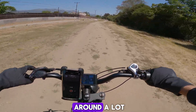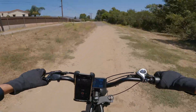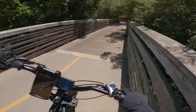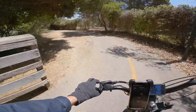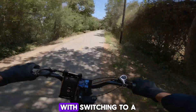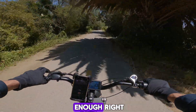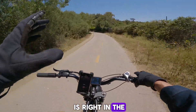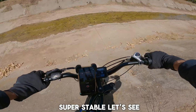It handles the off-road section pretty well — after all, this is a dirt bike frame. The kickstand does shake around a lot so I'm going to have to figure out how to tie that in. One thing I was a little concerned about with switching to a more dirt bike style frame was whether the center of gravity would be similar enough, but because I have this big battery in the center, the center of gravity sits right in the middle to lower end of the bike, making it super stable.